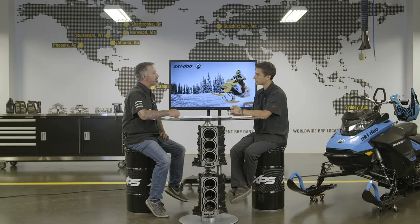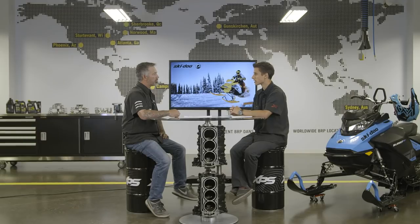Can you give me an example of why it's so critical to do these adjustments? Let's take engagement. Engagement will be calibrated to a specific type of segment to meet customer demands. To have a proper engagement, we will need to have a high enough RPM so that we can overcome drag and permit an acceleration of the sled without bogging.